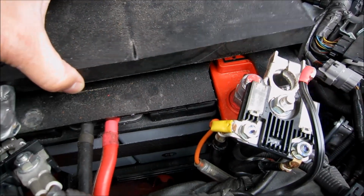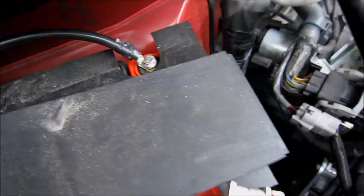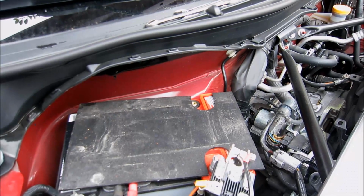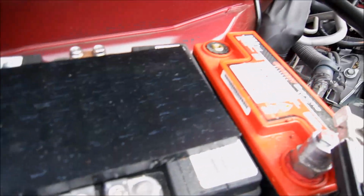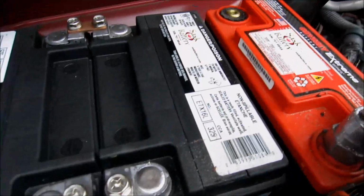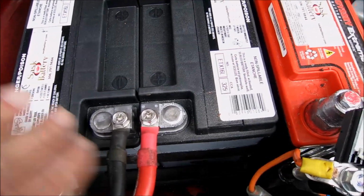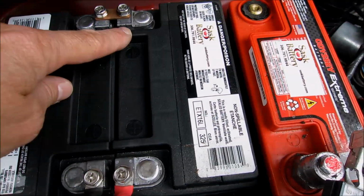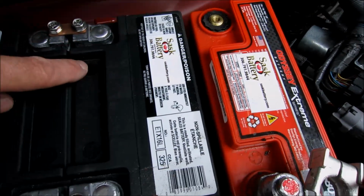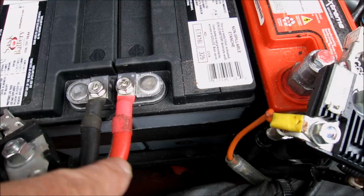This is a battery cover that comes with the electric supercharger kit, and it brings the negative terminal over from where it attaches on the actual battery. And we take the top cover plate off, and you can see all the different batteries. You can see how the 2 batteries are connected in series to produce 24 volts. So there's one 12-volt battery, negative connected to positive here, negative comes out here, positive in here. So there you go, a complete circuit.